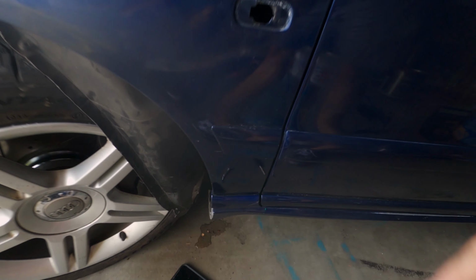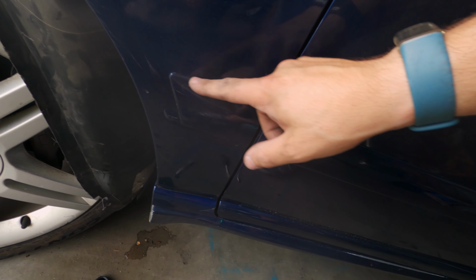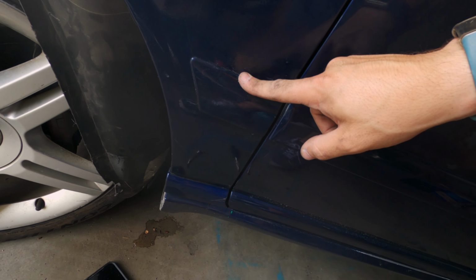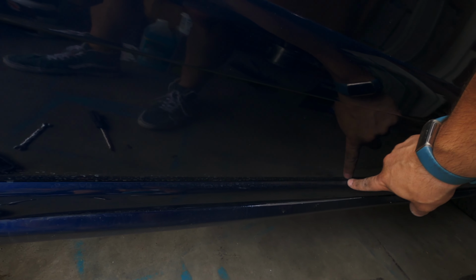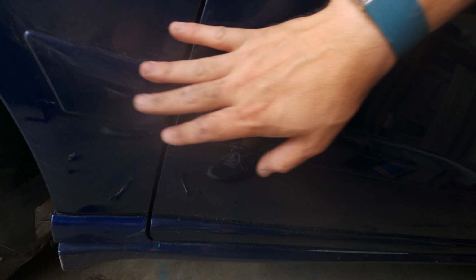There's a good amount of trim on this car, and specifically, we want to remove as much as we possibly can. There are 2 sets of door blades on the car. To make it look as good as possible, we want to remove these when it makes sense. The lower ones come out easily since they're simply screwed in place, but the top ones are riveted into the door, and I don't think we're going to remove those for our first attempt.